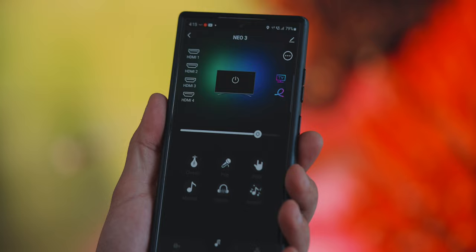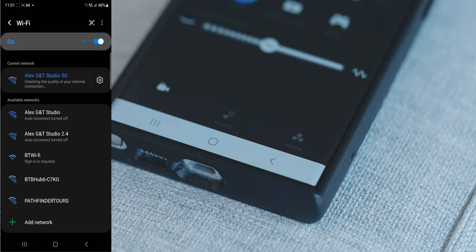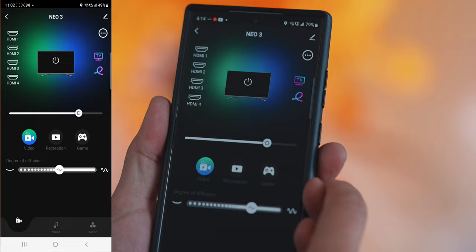And that's the installation bit done, but we're not fully done yet. Before you do anything else, we need to get the app. And here's the second gotcha, which is something that will save you a lot of frustration. Most WiFi routers these days will support dual bands - 2.4GHz and 5GHz. The Lightmei Neo3 SYNC box supports 2.4GHz, so in my case I needed to connect the phone to that 2.4GHz first to make sure the setup worked. Once you've set it all up, you can connect your phone back to the 5GHz network. The setup itself is very straightforward - the app is very intuitive, with three tabs at the bottom for the different modes, and a control section at the top where you can control the power, brightness, and the degree of diffusion of the light strip.